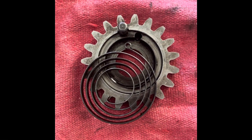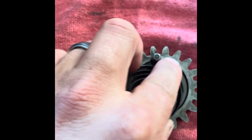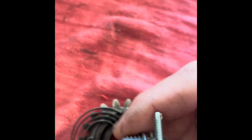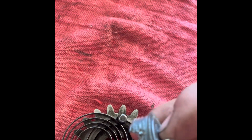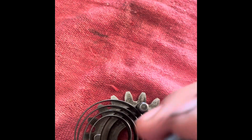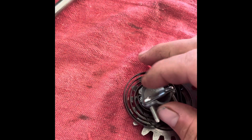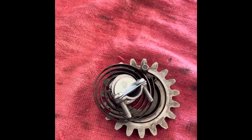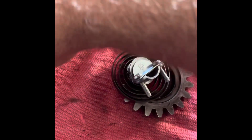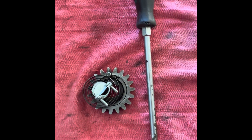This is the correct direction to wind your impulse spring. What you do is start by dropping it down in there, and this is what I made as a tool. I'm sure you can come up with something better, but this is what I had on hand — I'm an electrician. This is a Romex connector. I took the lock ring off and made a little notch in it. It sets in just like that — the end of the impulse spring sits in that notch. Then I use a big screwdriver and wind it up.